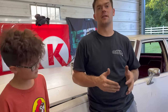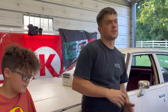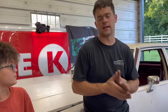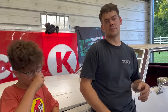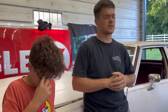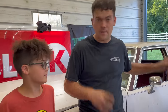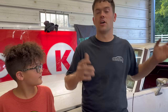We've always wanted to do some burnout competitions and we need a car that's really set up for it. We've got new front brakes and hoses. We're not sure yet what we're going to do with the master cylinder — we may have to convert it to something else. Right now our brakes are sticking. If you watched the 'Will It Start' video, the brakes work but just barely and they stick, so those caliper bores are probably rusted up. We're going to get the brakes on it, do something different with the wheels, probably weld the rear diff up so we've got a full-time Lincoln Locker in the back.